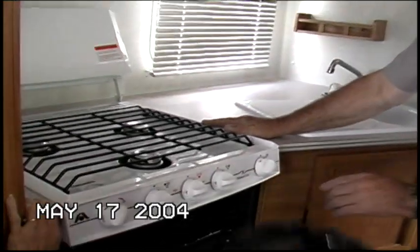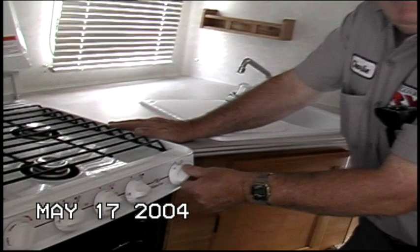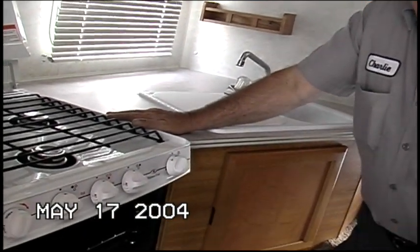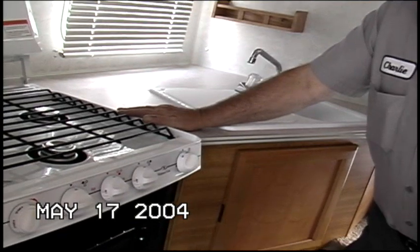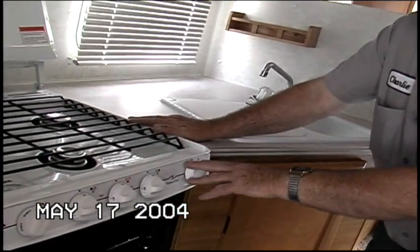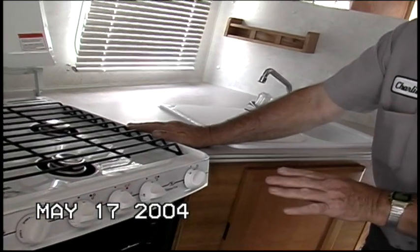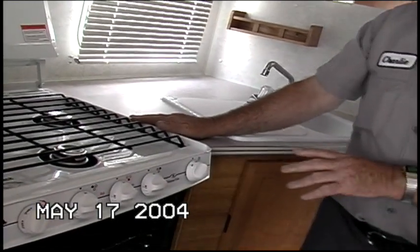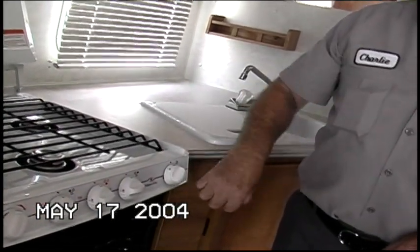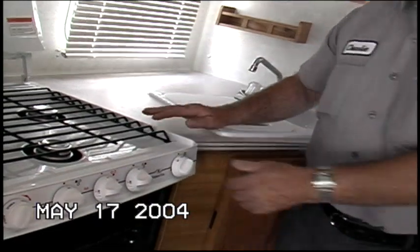When it lights, you turn that on there like that. It takes about a minute. The thermal coupling in there has got to get hot before she will light. Like a fire log. Once she's lit, you can just leave one pilot. Oh, okay. And all you got to do is turn it on. You ain't got to do that every time. Okay, that's cool. When you leave the campground, make sure she's completely off.